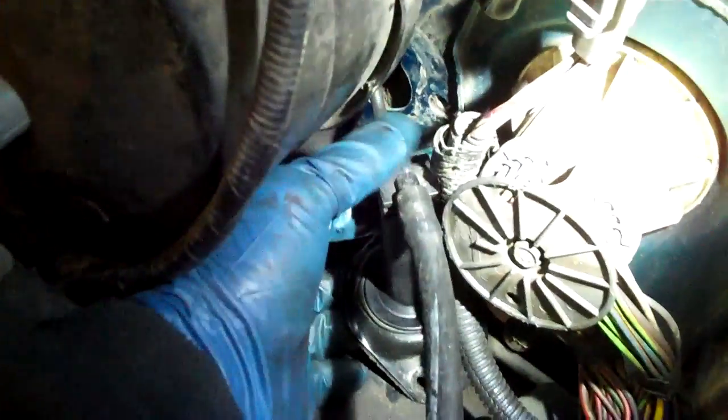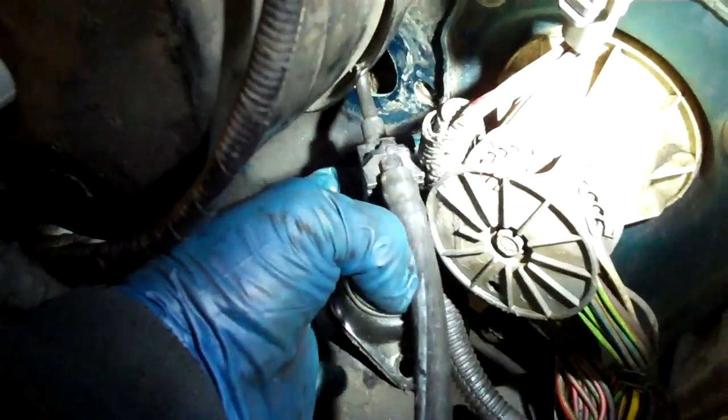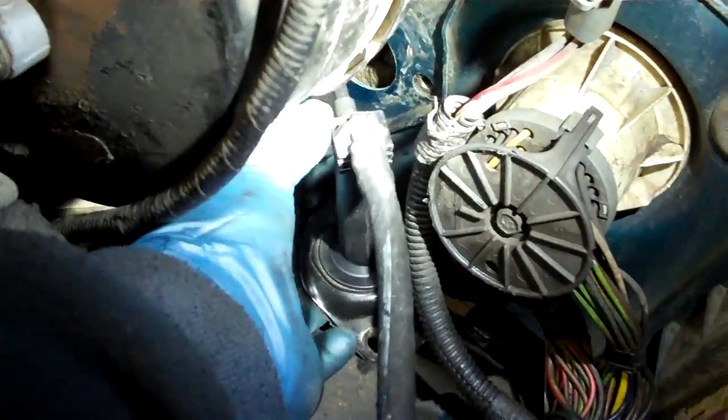Spanky, say hello. From underneath — I'm holding the reservoir over here and I watch until all the air bubbles are gone out of it. She's working with a long screwdriver from clear underneath the vehicle, and I'm having a heck of a time wrestling this back to where it was. It was like this — straight down — and that way all the air can come up this line without having to get it out of this abomination of a design.